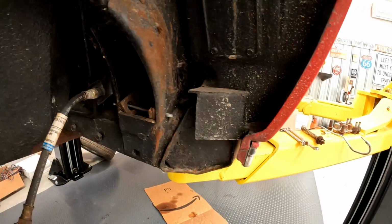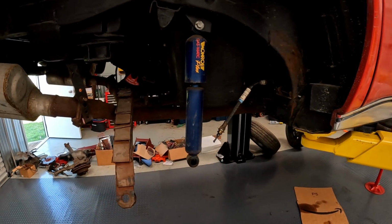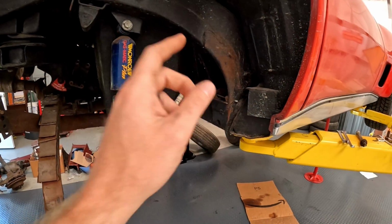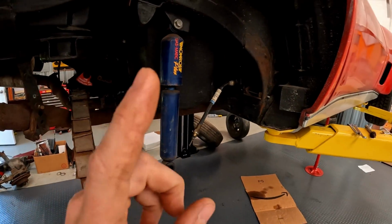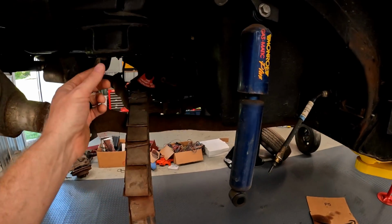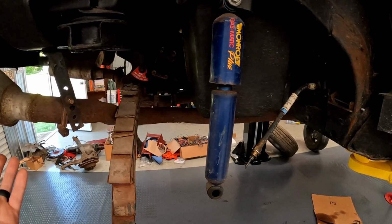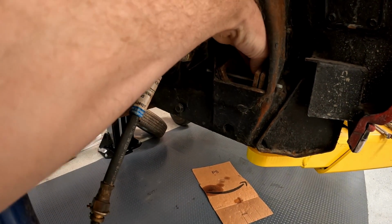But here's the thing, because the previous owner decided to upgrade their car with poly everything, I have to redo all of it. So I have to redo the bushings in the trailing arms, the bushings in the leaf spring, the bushings in the strut rods, but also I have to realign it, and I have to bleed the brakes again. So if the guy that had owned it, who knows how many previous owners before, had decided just to put rubber in, it would be all perfect and fine and there'd be no problems. But this is the main reason why you don't want to do poly bushings.